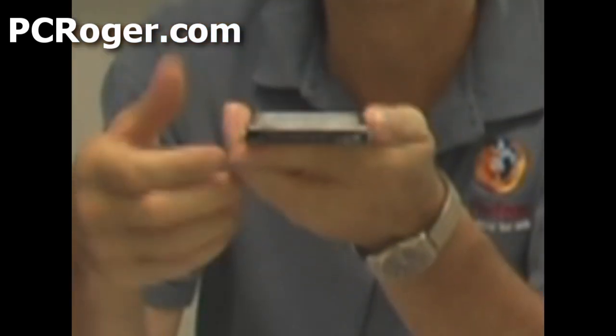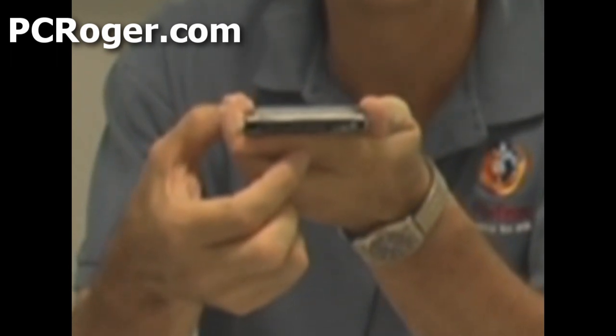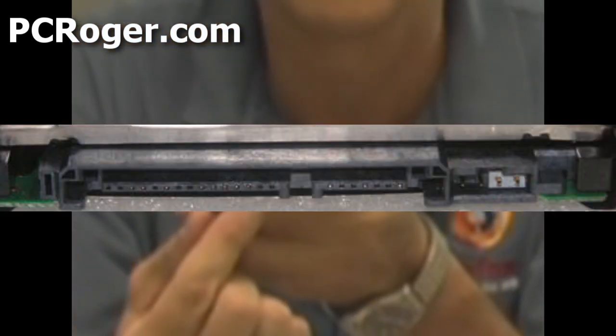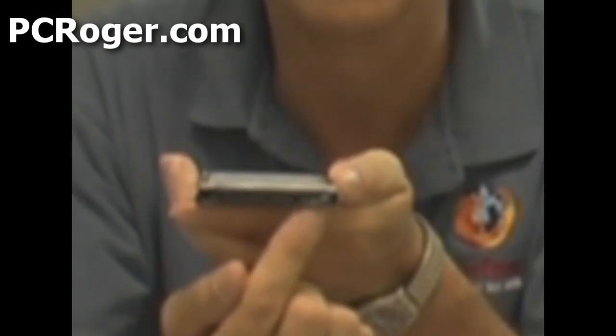Here's another laptop or netbook hard drive, and this is the new Serial ATA. As you can see it's got similar-style plugs to the three-and-a-half-inch desktop drive. There could be an adapter on this too, though I don't think it's as likely. Again, you have the L-shaped connector for power and the data cable, and there is one jumper and two sets of jumper pins for configuring the drive. A lot of times you don't have to configure the drive, but in a special situation you might.